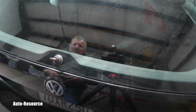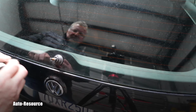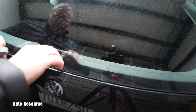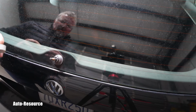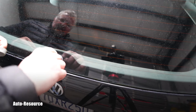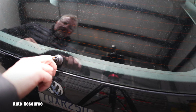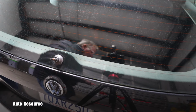Yep. I will install a very tiny amount of this Super Lube on the thread since it was stuck like that. Also on these grooves, I'll be pressing in that mount, which looks like brass, so we'll be basically imprinting these grooves on the shaft. Obviously we don't want to lubricate the threads so the nut will fall off, but I'm putting just a very little bit, to prevent the rust and help with future removal.